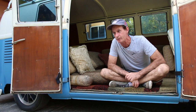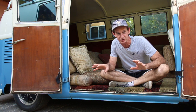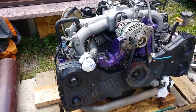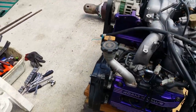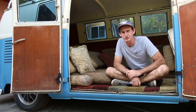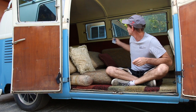After installing the new performance transmission with my original VW motor, I noticed I really couldn't use it — it was so much slower in fourth gear that I could barely go uphill and had to shift down to third almost every time, even on the slightest incline. So for those putting freeway flyer transmissions on a stock VW motor, you simply don't have the horsepower. I'd only had the transmission about a month when I found a Subaru turbo motor for sale. That solved all my issues. I went with Rancho Performance Transmissions because they're actually the only transmission company offering a five-year warranty — that's a no-brainer.